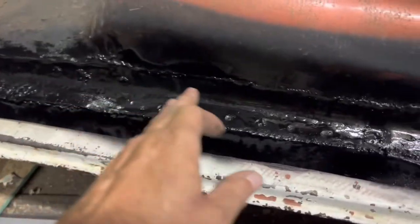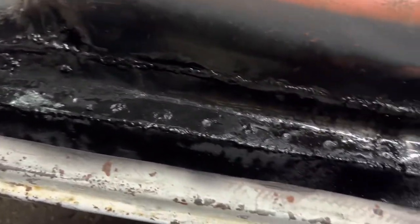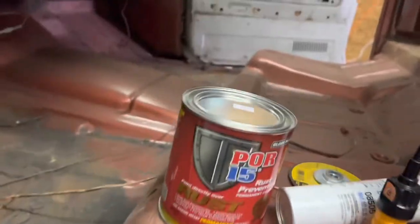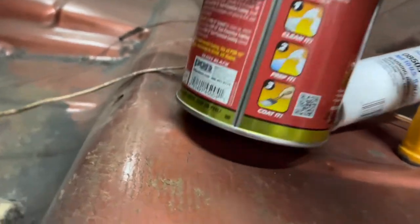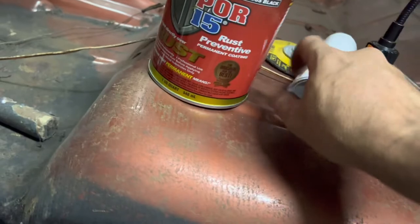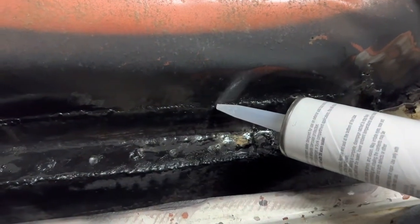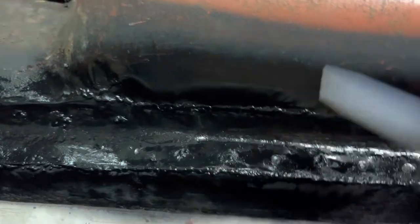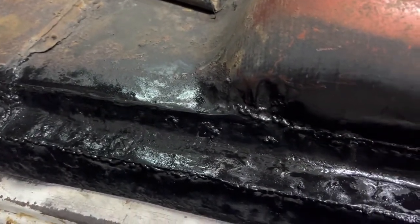I just got all my welds cleaned up and I took my light and shined it underneath — everywhere I could see a pinhole weld, I welded it up. It's not 100% but it's good enough for what I do. I sprayed some black spray paint on it and I have this PR-15 rust preventative — it works real good, you can apply it with a brush and it's self-leveling. This stuff goes a long way, I'll link it in the description. What I'm about to do is cut the outer rocker, get it in here, tack weld it in a few places, and then seam seal it.